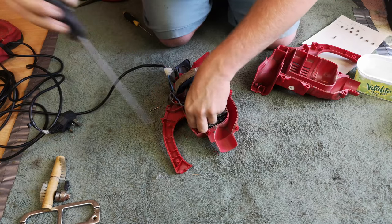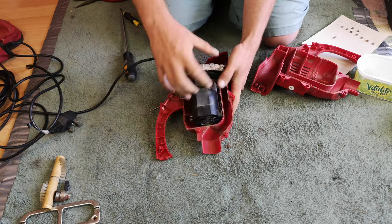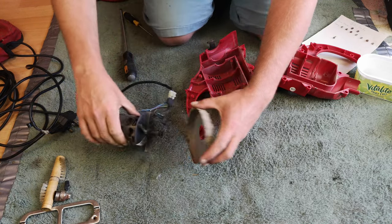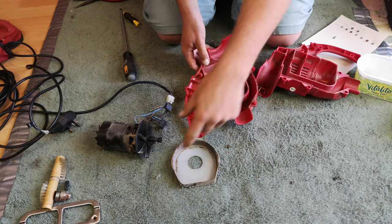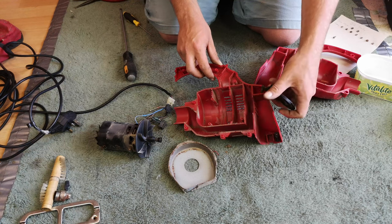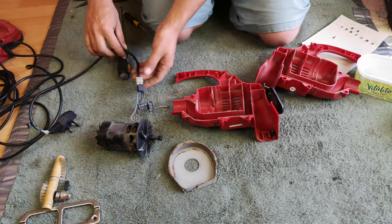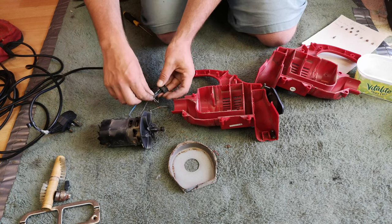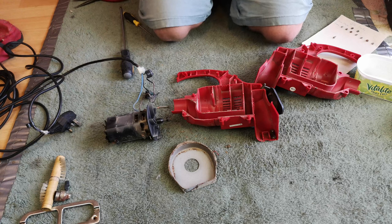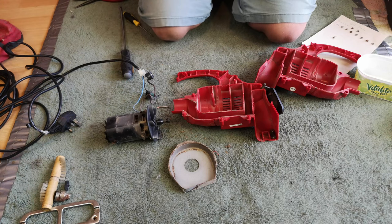It's been a little while since I've done a Dirt Devil Handy. Obviously don't do this live - it'll be awful for you. The motor and fan shroud thing will come out of there, as will this which literally just slides in. So remove that. I'm going to unwire the cables - I'll just unplug the live and then unscrew the neutral from the chocolate block, and then we're ready to look at the motor itself.